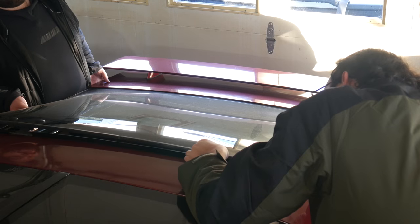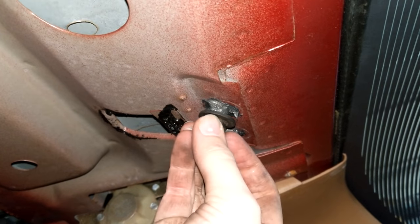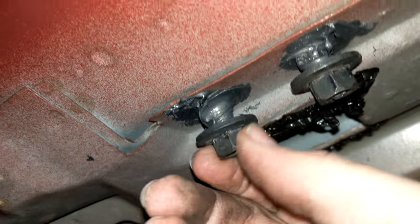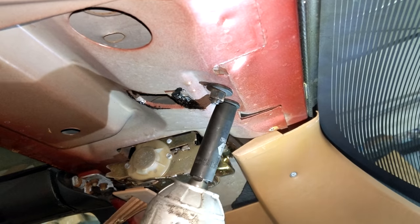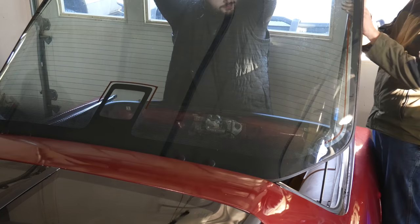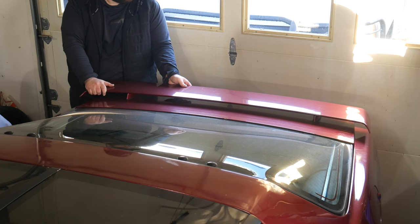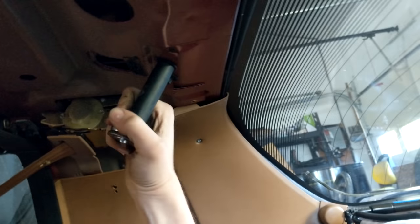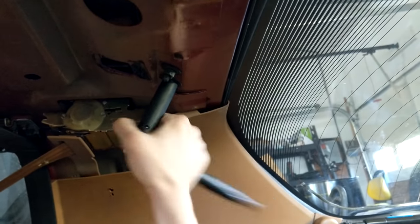We'll carry it back over to the car, carefully line up those hinges, and drop it into place. Once the studs are through the roof we'll coat the connection with a bit more RTV and thread the four nuts back into place. Once they've been started we'll very carefully snug them down. Once all four are against the roof we'll let them sit for a minute or two so the RTV can skim over. In the meantime, we'll lift the hatch back up and reinstall the lift struts. We'll pop each side in place, tighten down the screw, and reattach the wire for the rear defrost. With all of that back together, we'll fully close the hatch using the electric pull-down. With it fully closed in its resting position, we'll tighten those four hatch bolts down to the body — just use a ratchet to get them nice and tight. With the sealer on the threads, they shouldn't be coming loose anytime soon.